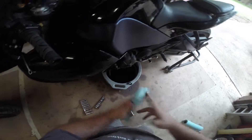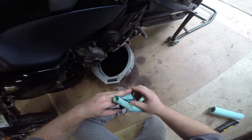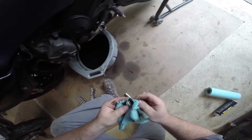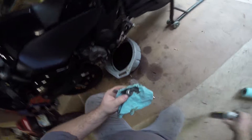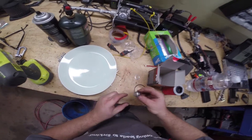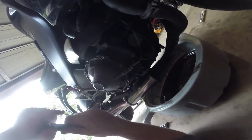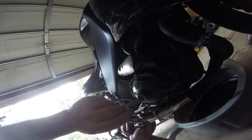You want to have a towel ready to clean up your hands a little bit, and we want to make sure that we clear off the particulate — this plug is magnetic. Get all that nastiness out of there. Our oil change kit comes with a new crush washer for this plug and a new crush washer for the other plug. This bike actually has a secondary drain bolt on the other side of the motor.